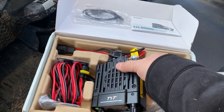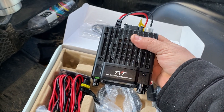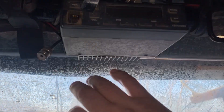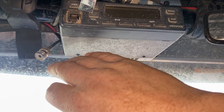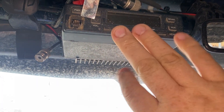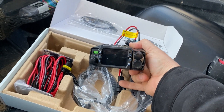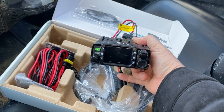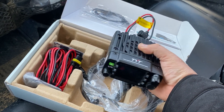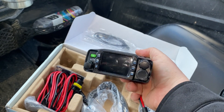We're obviously going to have our power cable. Here is the radio itself — a neat little guy. The reason I'm picking this one is because it is rated IP67. So when sitting inside the rig, if you splash around in mud and water sprays up, you want a radio that's at least water resistant. This also gives me dual channel monitoring, so I can have a main frequency to monitor as well as a GMRS repeater, a ham radio repeater, or alternate frequencies for racing like pits or weather. This is going to be a far superior design.